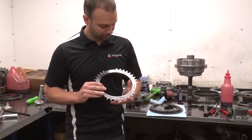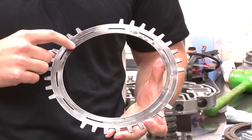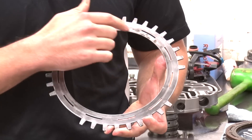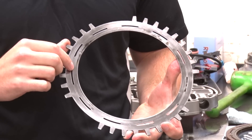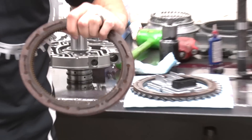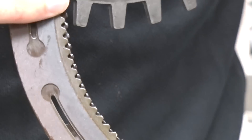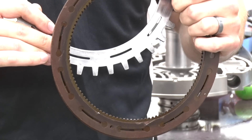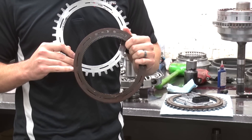You can see in the data just a little bit of slip, but we're getting hot spots on the clutches and on the steels. You can see that nice red-brown color on this clutch here, which indicates heat. It starts out just a little bit, and we can see it in the log file as the truck starts to pull fuel for what I would call no good reason.